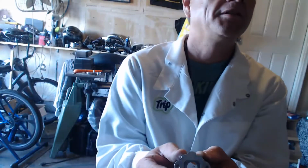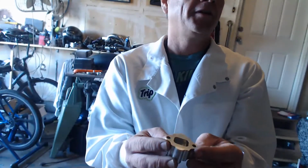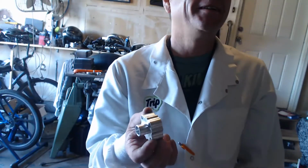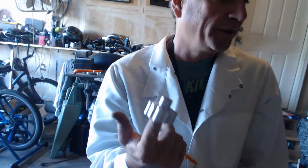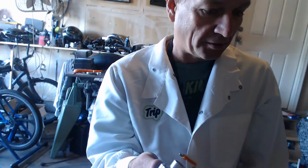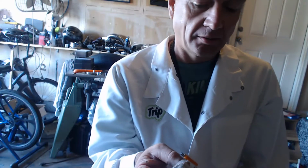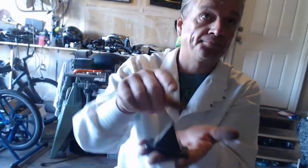Here is your basic reed box for an RSC. And a lot of people use them for other things other than the reed because the Oz reed is so much better than this. Why is this so bad? Because the reeds don't open fully and it doesn't have a chamber for the reeds. The reeds pop out. Why do I like the Oz reed? Because it is a lot simpler reed than this.